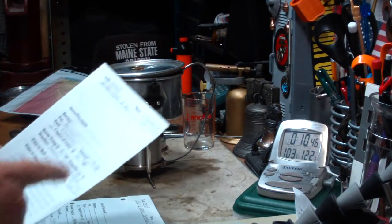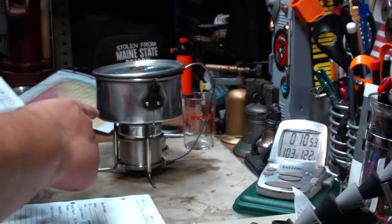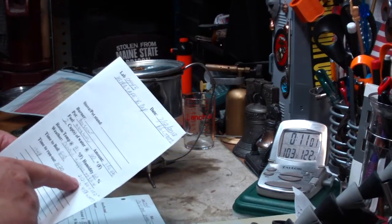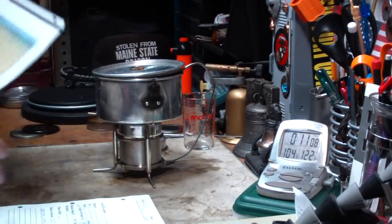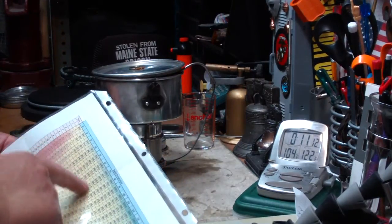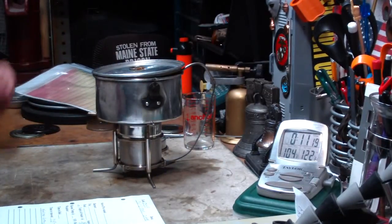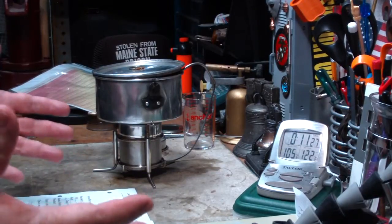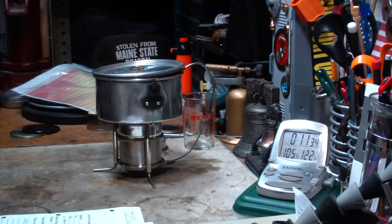On the earlier tests, I had two boil tests and they both came out to about the same time. Two cups of water — and this was two cups of water, it was a measured water — starting at 60 degrees came to a boil in 6 minutes, 12 seconds. So that's 212 minus 60, 152 degrees in 6 minutes. The highest this goes is 150 in 6 minutes. Works out to 458.3 watts. So that's quite a difference: 73.3 versus 458. I think that's a simmer, and it is putting heat in — it's rising just slowly. So this might be a good simmer to use for it.